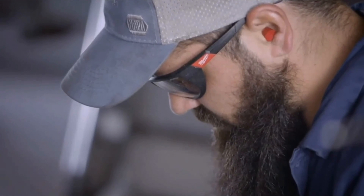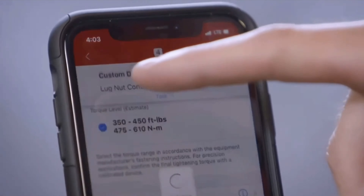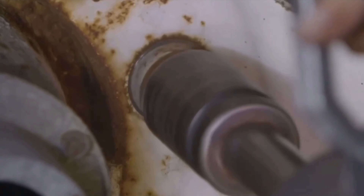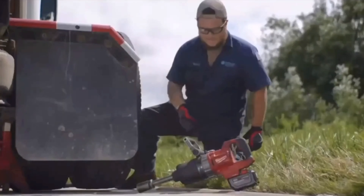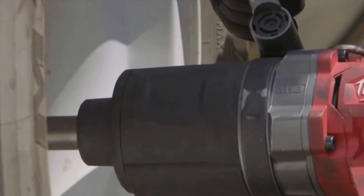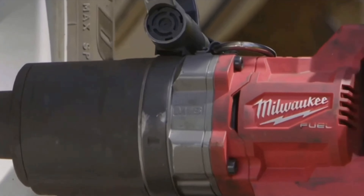As far as the lug nut mode, it actually prevents stripping, which is a big thing — especially when you get technicians that may be a little newer. I like the lug nut mode because you know you're not going to over-torque the lugs. With some of the bigger air impacts it doesn't take much to strip a lug. That's the game changer. The biggest benefit is the versatility — the ability to have a mobile unit, because the battery life is long and it works with the same power as something attached to air.